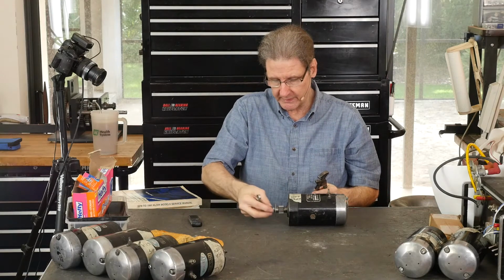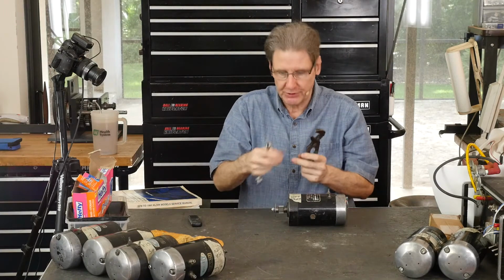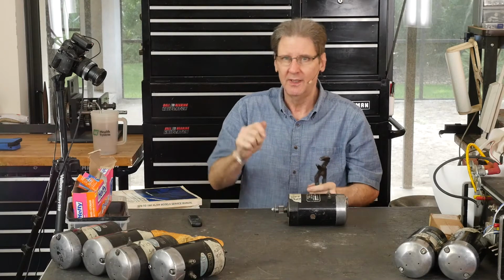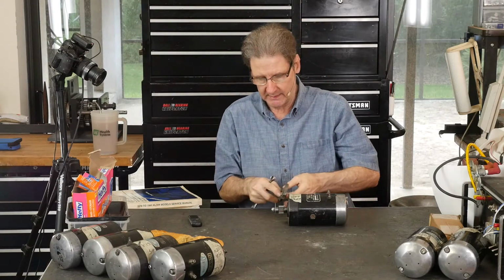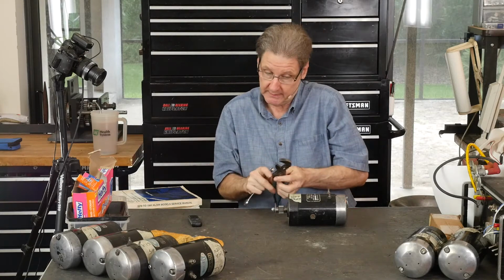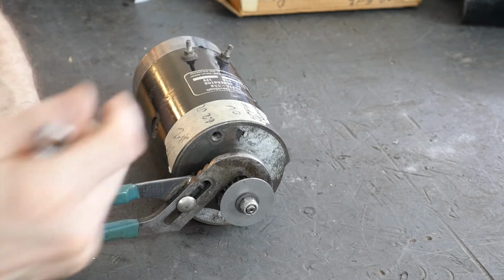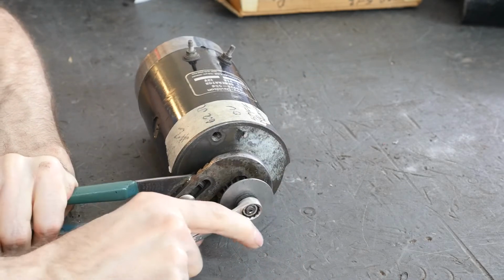When you pull this prevailing torque nut here on, it's actually pushing the gear onto a round part of the shaft, and there's a lot of pressure. So trying to gauge, I really like to feel things as they tighten. I've been doing this for years. I've had other mechanics say, yeah, that's what I do. Take a big channel locks and a 1/2 wrench.